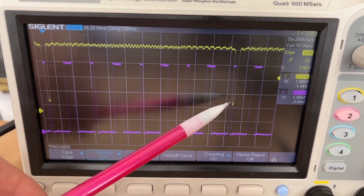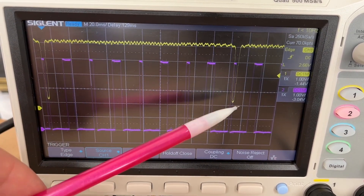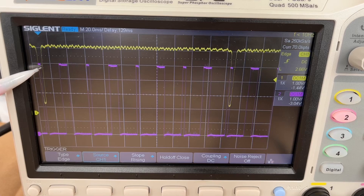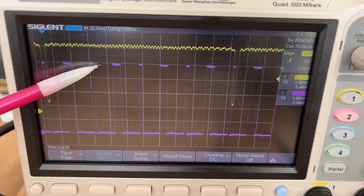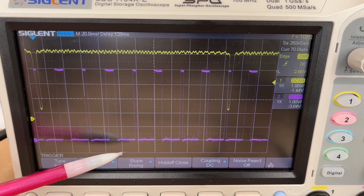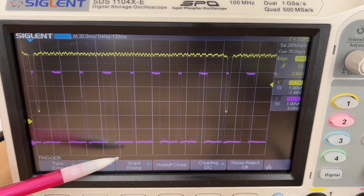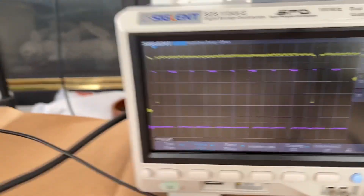We could try to measure time — we know it's 360 degrees to go one revolution — so we could look at the time between pulses and figure out what the angle is. But as I was saying last time, that's a lot of work, and I'd rather have the computer do that. That's what we're going to do here with the Arduino.